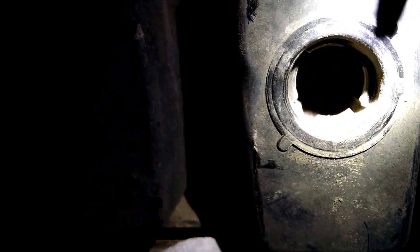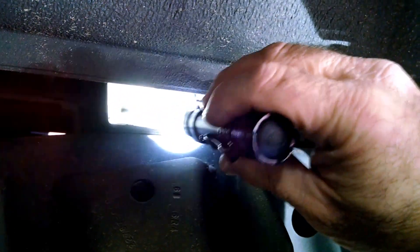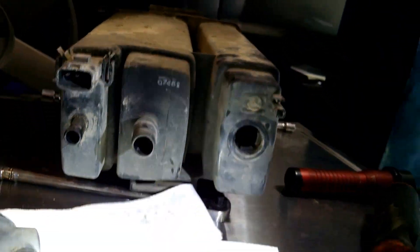That's causing our problem. If you look at where the vent tube goes, it goes to that valve, up through this vent into this little frame pass-through. This is a four-wheel drive truck, and if you look at all the mud and debris down that rail, it doesn't take a lot of imagination to understand how it all just gets into that plastic piece. There's no vent or filtering into that, so it's literally sucking it down that tube back to our valve. That's the end result of years of off-road driving.